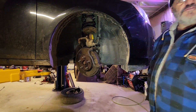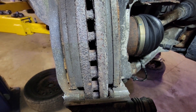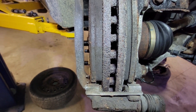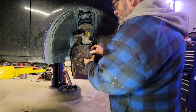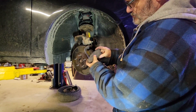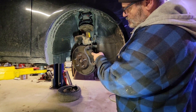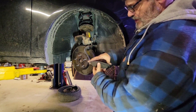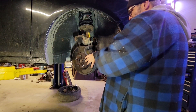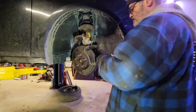There's quite a bit of difference in the pads here. You can see the inner pad is about 30–40 percent less than the outer, so that's never a good thing. Once you've got those out the pads themselves will fly out — not too bad, just a little bit of a groove at the edge, which is common. That's where the rust tends to accumulate, but that pad is fine — you could technically reuse it.